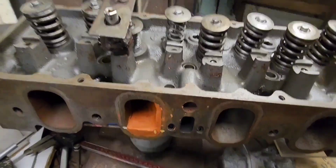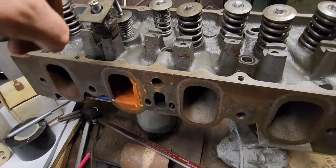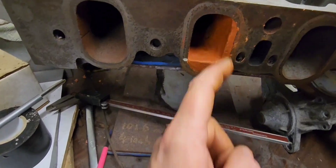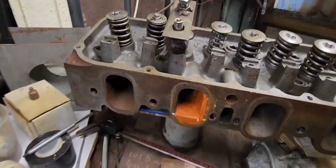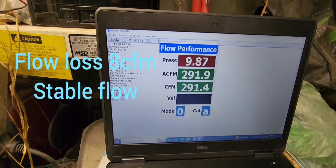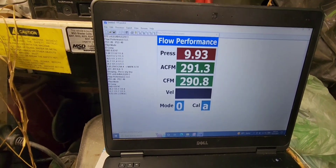All right, back on the bench. Valves are at 0.65 inch with the extra piece of clay in there. The test today was conducted under the idea of what port stuffers were originally designed to do, and that was to reduce the area of the intake port yet maintain the flow, so this would increase the ramming effect into the cylinder.